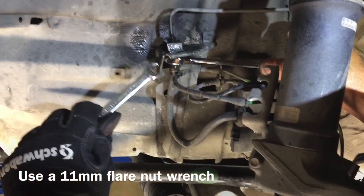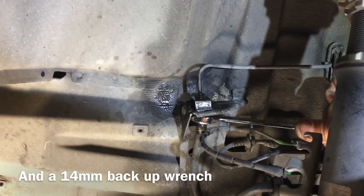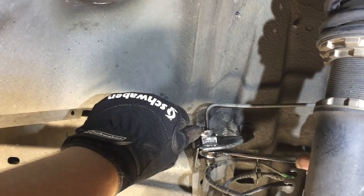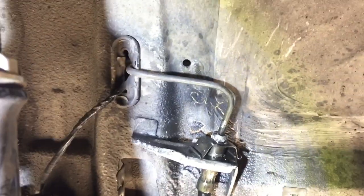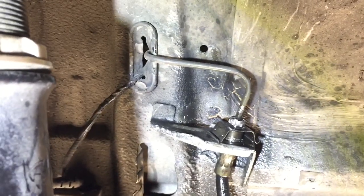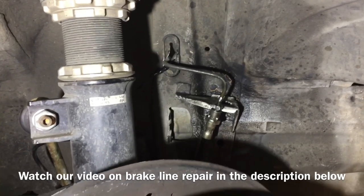Use your 11 millimeter and a 14 millimeter backup wrench. We use the backup wrench so we know we're not going to twist that line when we break it loose — because these are OEM lines that have been on there a long time, and you can easily ruin them. If they're really locked tight, use a little lubrication to break them loose easier. If you're replacing OEM lines, the nuts may be corroded to the hard line, and you may have to cut the line and reflare it. If you find yourself in that predicament, refer to our other video linked in the description.